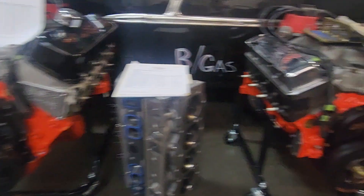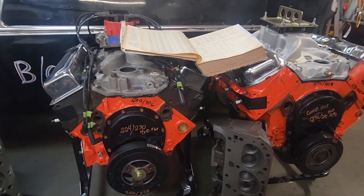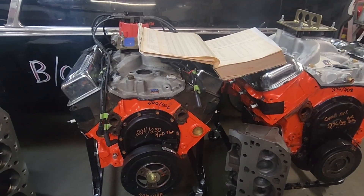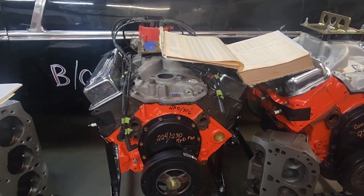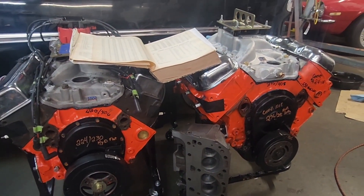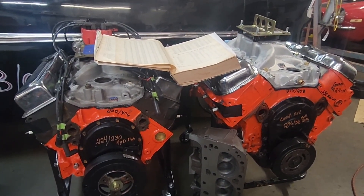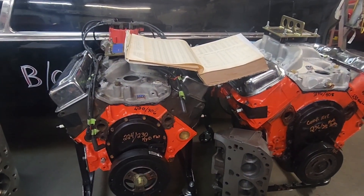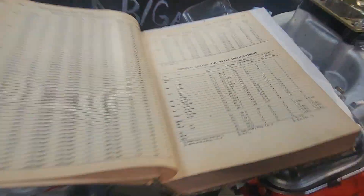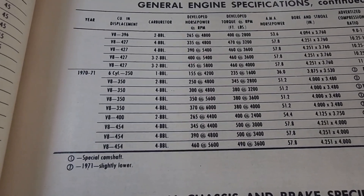I want to go over some of the stuff about my test I did last week. These are stock rebuilt motors. I got lots of great comments from people about this test, but I did get some people that thought I ruined the small block by putting two-barrel heads on it. That motor came out of the factory with two-barrel heads. These are motors that I bought on Facebook Marketplace — I gave $800 for the 400 and $1,200 for the big block. I did a pocket port on them, changed springs, lapped in the valves, but these were motors rebuilt in the 90s, not balanced or blueprinted.